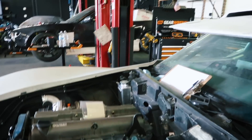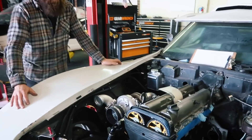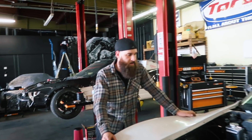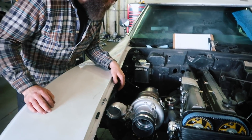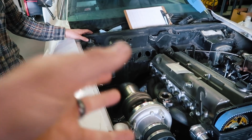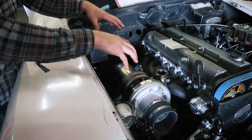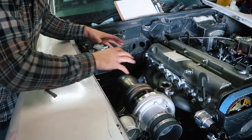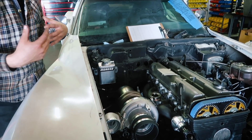That's all the work done so far. It has a lot of similar parts you'd see on a race car because the customer wanted the craziest 2J motor build. Joe's next step is to pull the motor out because it'll be easier to add a wastegate to the bottom of the manifold — he's got to drill and port that. Since the customer doesn't want it loud, the dump tube will return into the downpipe. We now know spatially there's plenty of space for the wastegates and dump pipes.